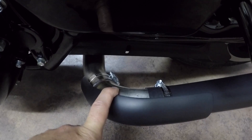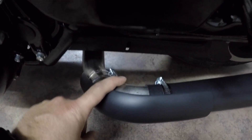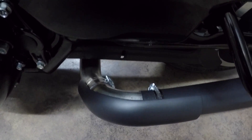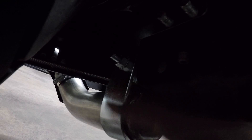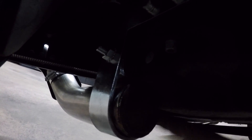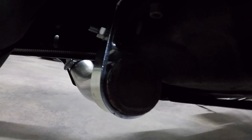There are two bolts that go into the case and then there's another bolt that has the clamp that holds this on. It's very easy, very simple install. It's kinda hard to see under here because it's dark, but there are two Allen bolts that this bracket bolts to on the back of the transmission case. Then you have the clamp that holds the dummy pipe or the ghost pipe, and there's one bolt here that's a half-inch nut. You go ahead and tighten that up and this is solid and sturdy and attached to the bike — it will not move.